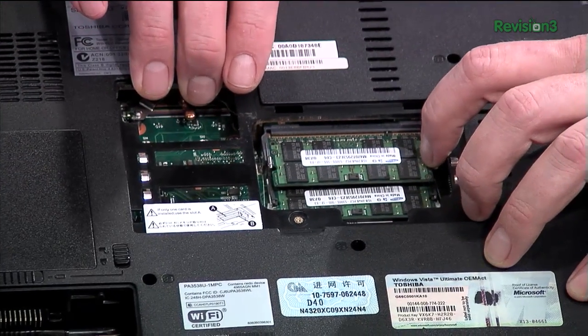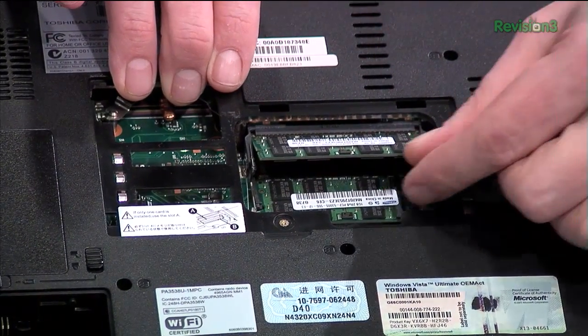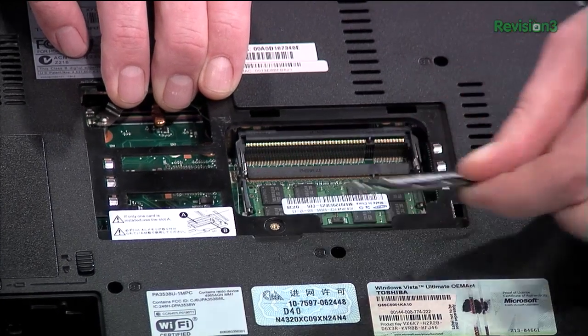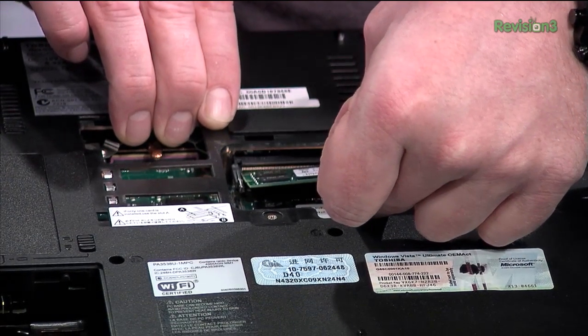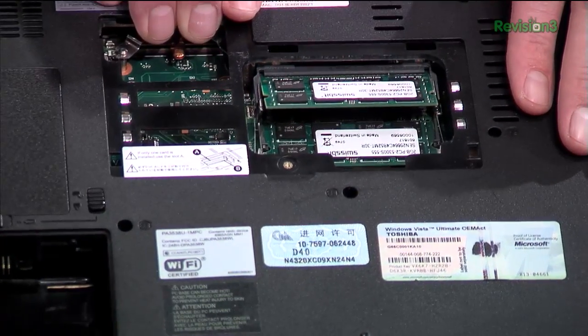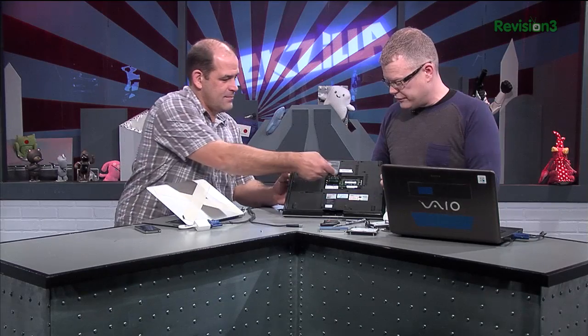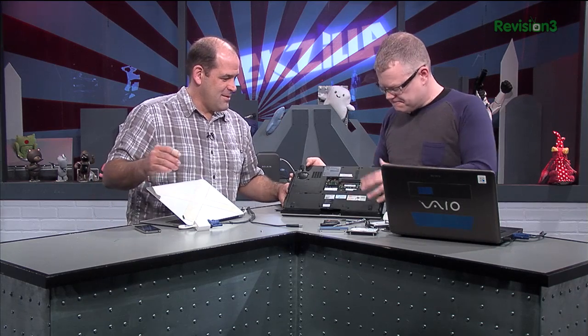For notebook memory, there are two little tabs on each side to pop it out. You just barely slide these little tabs on each side and you should get a little response as it pops up. Then you remove the module straight out and replace it with the new module in the same orientation — watch for the notch, it goes right back in. Do not drop your memory inside the computer. You just kind of leave it there and give it a gentle press down. Once it's in the slot, you just press it down and it locks itself into place. There are two modules and you have to do the bottom one first. To get the one out from underneath, you have to remove that top one first.